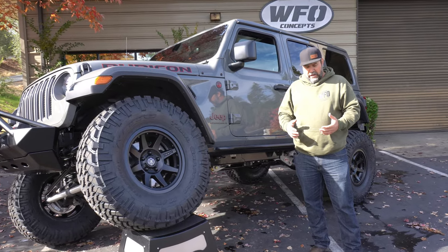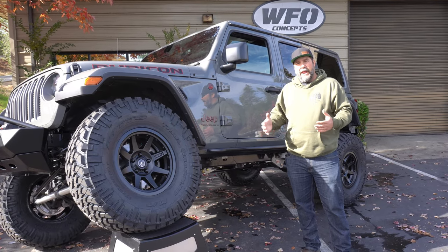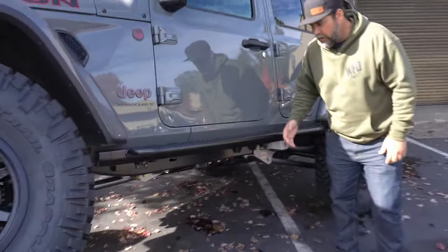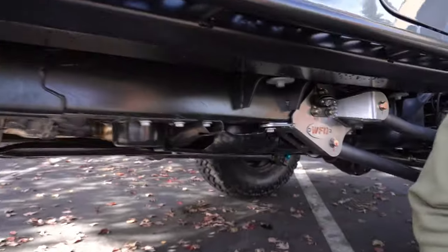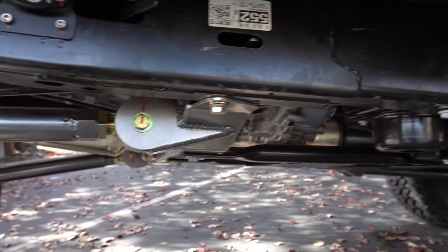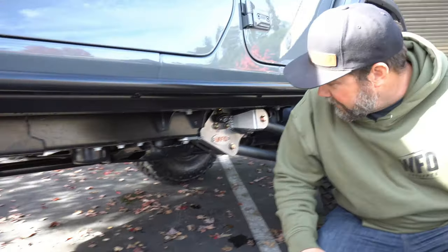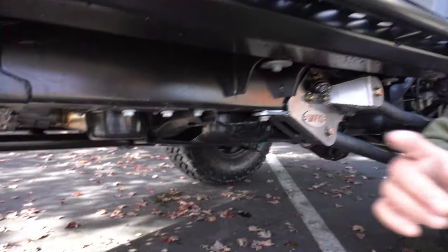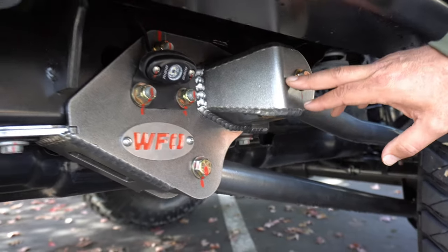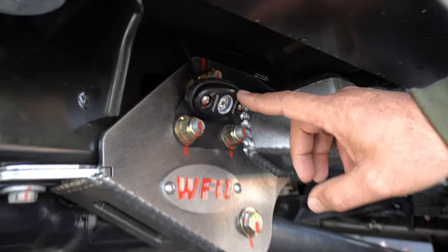This package is 37-inch tires with a three-and-a-half-inch lift, and we went ahead and put our long arm kit in it. If you sneak underneath and check it out, it has our JLU long arm kit on the diesel — and yes, it does fit on the diesel, though there are a couple of small mods required. One of the harder parts is you have to take the entire exhaust system off. You can see the long arm kit fitting on the diesel, the three-and-a-half-inch lift, and the rear bracket. Some of the add-ons include the Rigid lights right here.